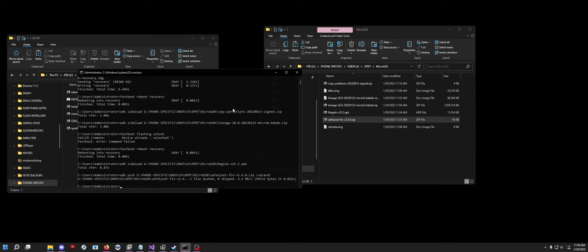You want to tap the Magisk icon and actually let it download the full Magisk Manager and install the APK for Magisk Manager. Once that is installed, you do want to allow notifications for Magisk, just for when there's updates and stuff. It doesn't hammer you with them like other apps do. There is a required additional setup step where you have to reboot the phone again. But I'm going to reboot my Android device real quick because I just put Magisk on it. Once that's done, I can go back into Magisk, enable systemless host, and install the SafetyNet fix and enable the new version of Magisk Hide.